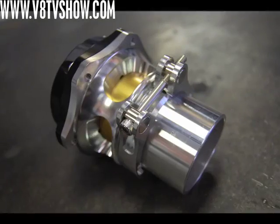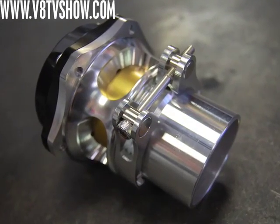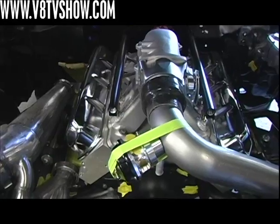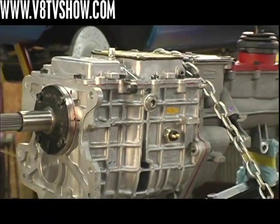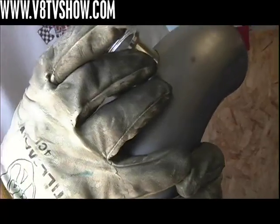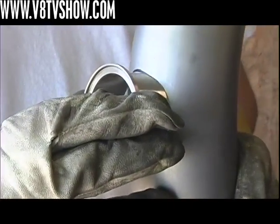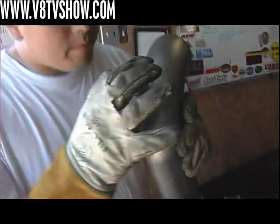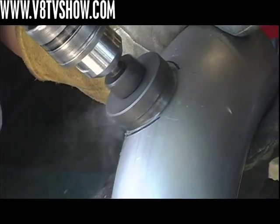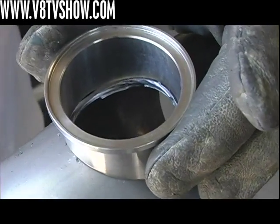The purpose of a blow-off valve is to relieve pressure on the intake side. For example, this car is going to have a manual shift — it's got a TKO 600 five-speed manual. If you step on the gas, you spool up the turbo, step on the clutch, put it in gear, and take off. Well, when you step on the clutch to go to the next gear and get off the throttle, it closes that throttle blade. If the system's under boost when you close that throttle blade, that boost builds up and has nowhere to go — it can actually reverse and stop the turbo from spinning.